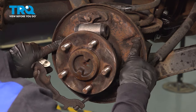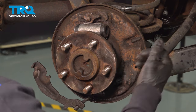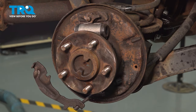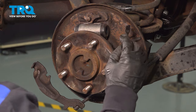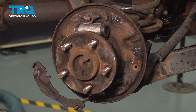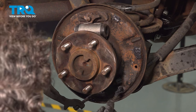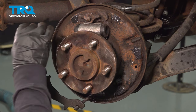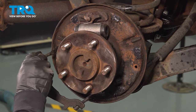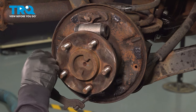You're going to have to pull the wheel to see how your brake shoes are doing. Now I'm going to apply caliper grease to the highlighted contact points before installing the shoes. You can be generous with it — it stops the shoes from being metal to metal and lets them glide smoothly. Caliper grease is different from regular grease: it has a higher temperature meltdown point so it doesn't get hot and contaminate your shoes.